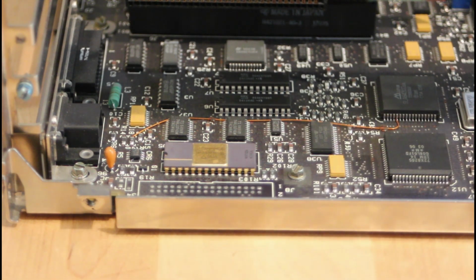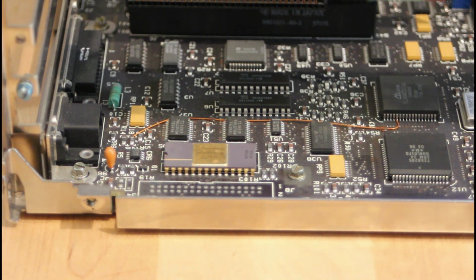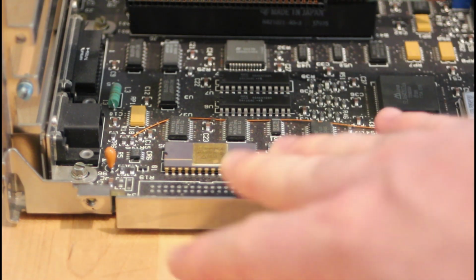So something that you should know about the MCGA is that it was basically based on CGA, not EGA. So CGA came out in 1981 and EGA in 1984, but instead of building on the latest standard, IBM did a fairly good CGA implementation here. A lot of the features and registers of the CGA CRTC are actually available in the MCGA implementation. And in fact, it doesn't offer EGA modes at all. So this is rather interesting.